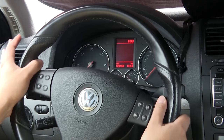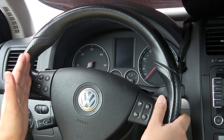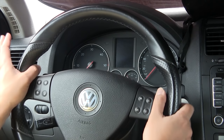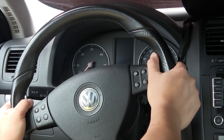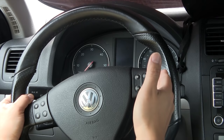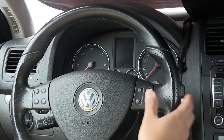When you turn the steering wheel to the right, it loads the left side of the car, and if the bad wheel bearing is on that side it'll get a little bit more noisy. If you turn to the left, it loads the right side of the car because the car leans that way, and that will increase the noise of any suspect wheel bearing.